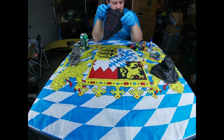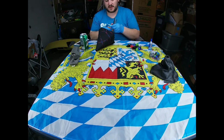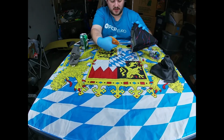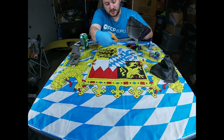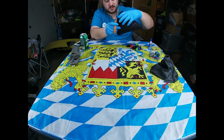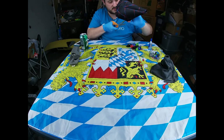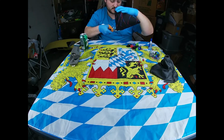Alright guys, that's probably good. So this is when it will start looking like more of a shift boot. What you want to do is every inch or so, every couple inches, make a little incision up to the bottom of the plastic frame. So just cut up into the plastic frame, but don't go above it. Just cut around, about 4 or 5 times, or 3 or 4 maybe on each side. This will help you cut off the excess so you're not cutting one big piece.